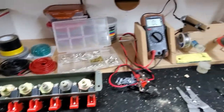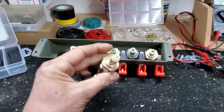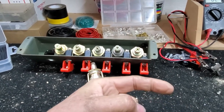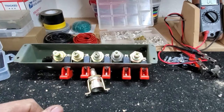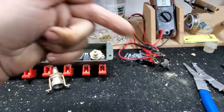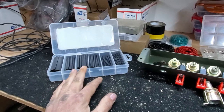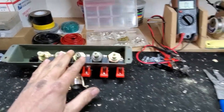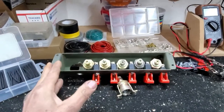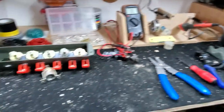The wiring is going to come into the switch first, and then the top wire here will connect to one of the terminals on the back. The wiring from this will go back to where the relays are and throw the relay so that the lighting can work. I'm just routing power through the switch to the light and back to the relay — that's how it's going to work. I'll be using heat shrink to cover the terminals so they don't short out. That's the way the light panel is going to be working, so let's get started.